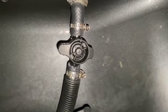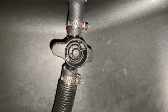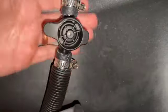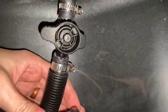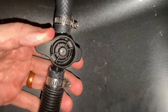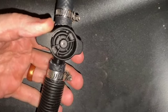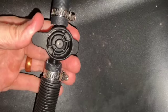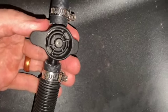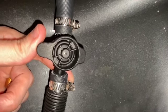First thing I had to do was deal with the visibility spout. Some people on forums and Facebook pages just totally disconnected it. But I have daughters that ride this sometimes, and I'd like to have the visibility spout still as an option for them on the safe side. So I put in this valve that I got on Amazon. It took maybe 15 minutes to install — pretty simple. I cut a little section out of the hose, put the valve in, and clamped it down. Now I have the option to turn the visibility spout on and off.